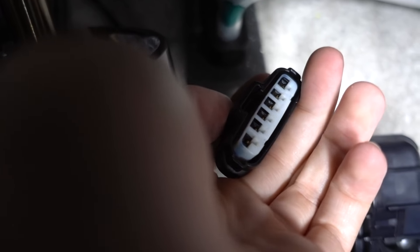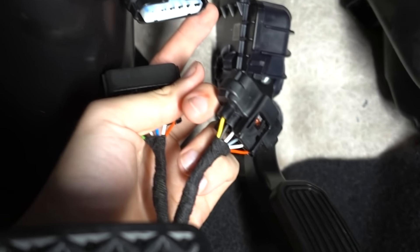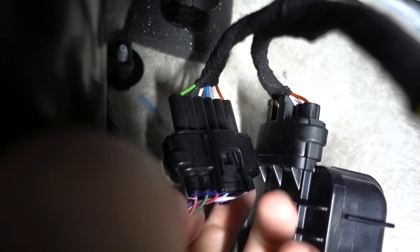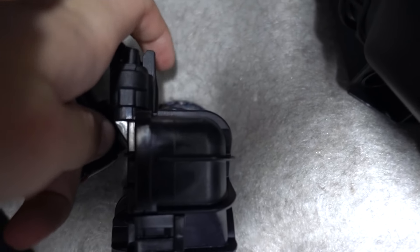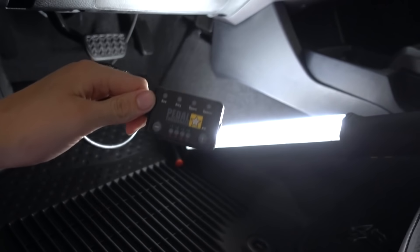Alright, so it's off — now you have this piece. It's super straightforward: you can see there's a female end, you plug the male into this, and then this back into there. It's like 30 seconds later and I've got everything plugged in. You'll see it once you get it, but you have the red wire on the outside going to the white wire, and the pink wire going to the green one on the outside. And then this will just pop on with the latch on the right side of the truck. Now y'all can see — got this super bright light for y'all. Now we'll start it up and go through the menus.